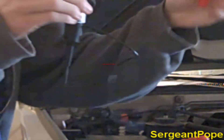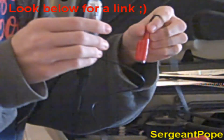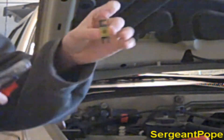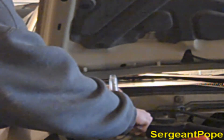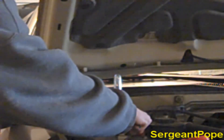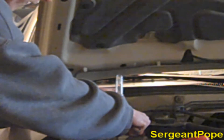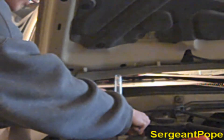To charge a capacitor, I suggest you get one of these 12-volt testers — you can find them at Home Depot and similar places, and I'll put a link in the description. On your fuse box, first take off the fuse, then on the side closest to the battery, touch the tester firmly there, and then touch the other side firmly too. Since my capacitor is already charged it won't visibly charge, but that light will be lit. You just wait for the light to go all the way down, and once it's all the way down, that means it's fully charged.